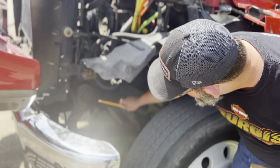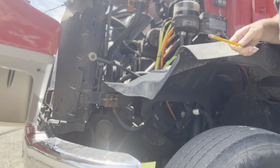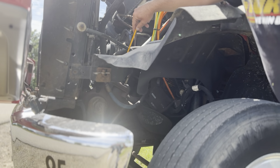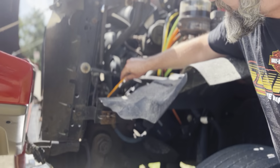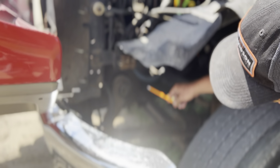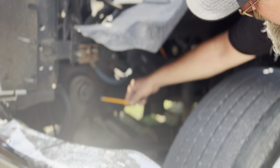So, steering box and hoses. So this is my steering box right here. And these are the hoses up here and up here. The hoses right here, there's no abrasions, bulges, cuts, it's not cracked or leaking. They're also securely connected to the steering box up here. It's not bent, broken, or cracked or leaking at all. The steering box itself is not cracked, bent, or dented at all.